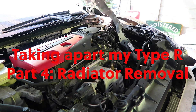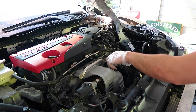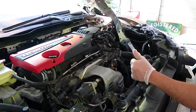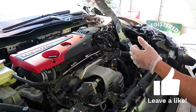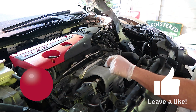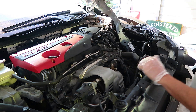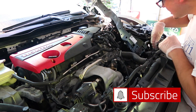We're starting to run out of lights, and that's okay because I don't even have the proper 22 millimeter O2 sensor remover that this does need. Unless I want to cut it and buy a new one, but I'm not going to do that. So I just ordered a new sensor — it'll be here in a couple days. When I install the new downpipe, that's when you'll see the video for when I remove this. So we can hold off on that. We'll continue on with the radiator because the radiator's got to go.